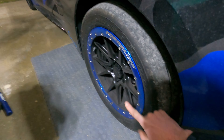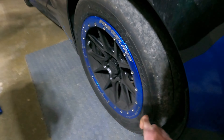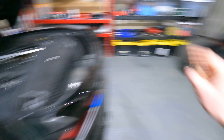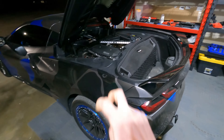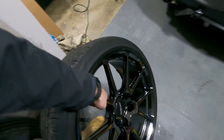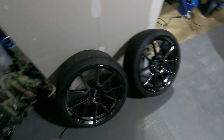I have the beadlock for when this thing has over 1,000 horsepower. Right now I probably don't need the beadlock, but it looks cool so we're doing it live. So that's a 325 on an 18x11 versus the 21x12 — same section width tire, 30 profile versus 35 profile. The 18-inch is definitely a small diameter tire. Now for fronts, these Forgelines are very light — I can pick them up with one hand easily. I'm 6'3", 215 lbs, just to give you some perspective.